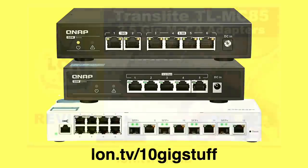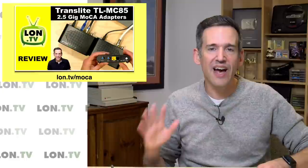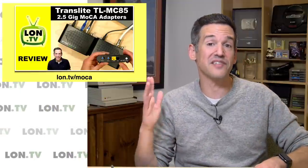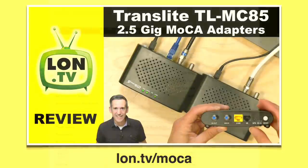If you're not interested in running Ethernet cabling everywhere, take a look at MoCA. This is a network extension technology that works over your existing cable TV wiring, and I have found it to be the next best thing to Ethernet — very close if you've got it set up properly. Right now there are two lower-cost adapters I like: Translites and another brand called Go Coax, and both seem to be delivering good performance close to their advertised speeds. In full disclosure, the MoCA Alliance has sponsored videos on this channel in the past, but I was a fan of it before they approached the channel — it really works and it's so much better than Powerline.